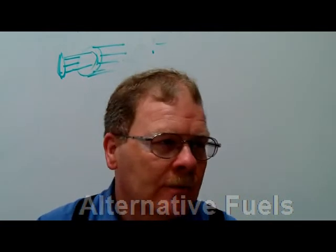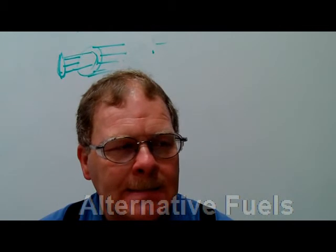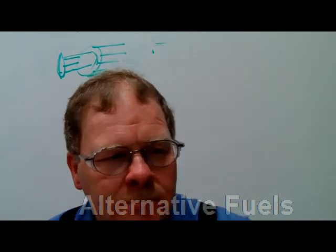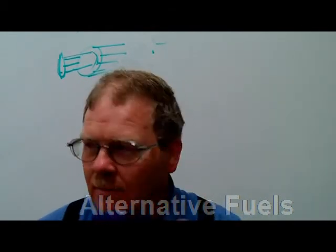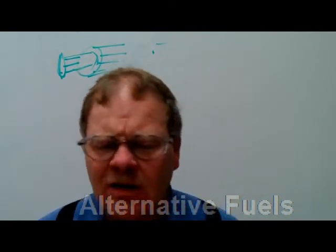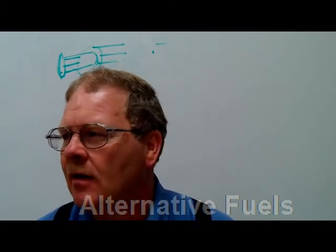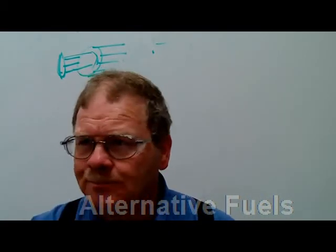Usually it's referred to as like 15:1, just a generic term. And I think the ASE test, when it has some drivability questions, will give options, and it's saying 15:1. Yeah, they round it. But for eons, we've heard 14.7:1. That's all I've ever heard. That's all I've ever seen.